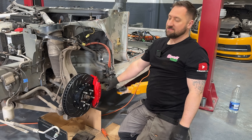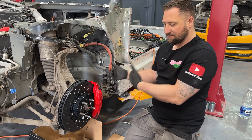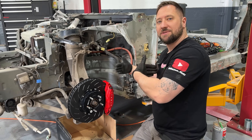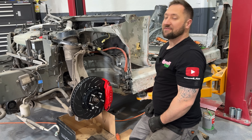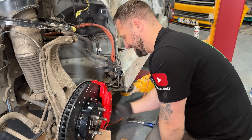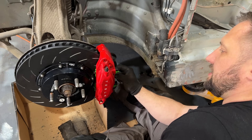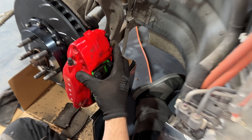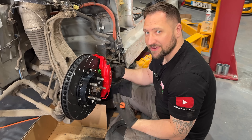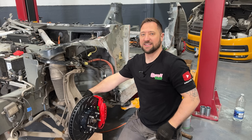I've left the caliper bolts slightly loose — on four-pot calipers, if they're not completely pushed back they'll keep pushing the pistons side to side, so this little bit of play gives me more room to get the pads in. Then I'll tighten them up once the pads are in place, because the pads will push the pistons back evenly. There's probably a tool to do this perfectly but I don't have it, so this is how I'm doing it. One pad in — and the spring clip is nicely in there holding it in place.